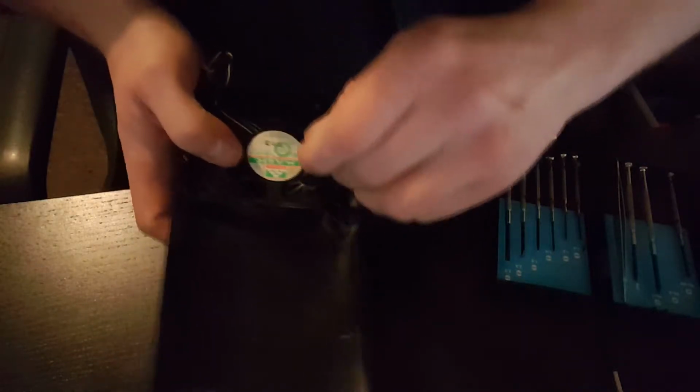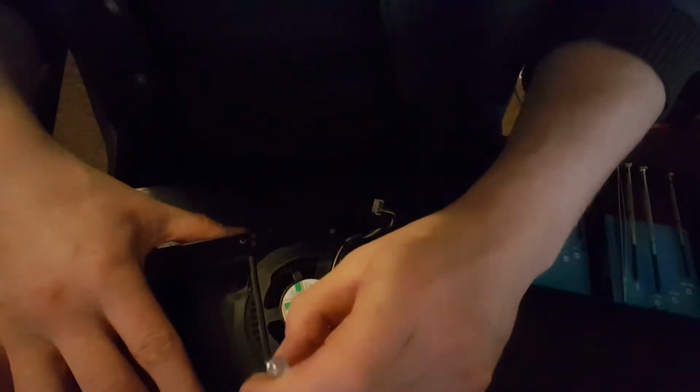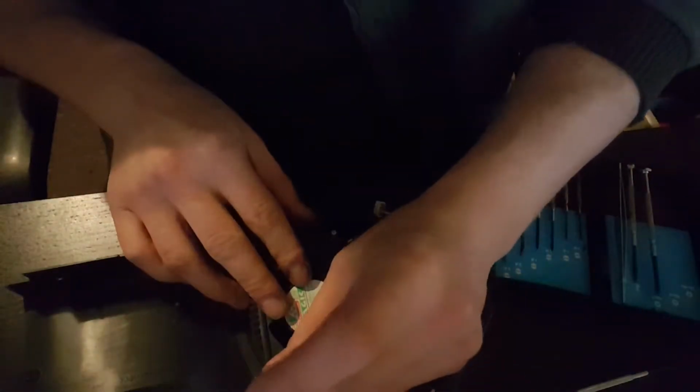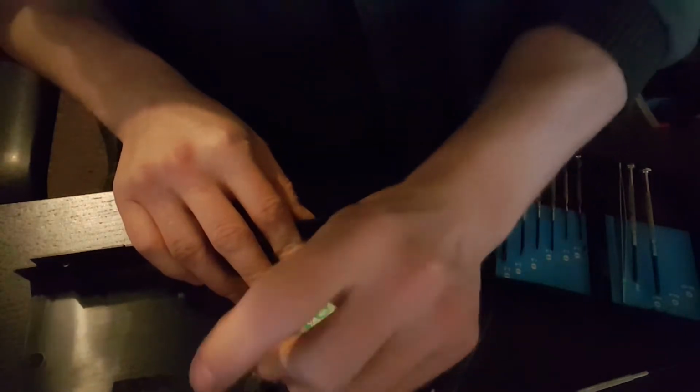Some people get fluff problems more than others. You know, you keep your computer on the carpet or whatever, you gather a lot of fluff off the carpet. Carpet's like fluff. Fluff likes carpet. One of the two. You get the idea. Right. Tiny little screwdriver. I'm going to clear the fan out as well, since we're here, and then we're going to slap it all back together with some new thermal paste.